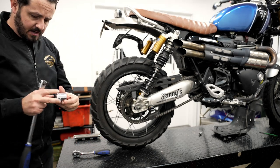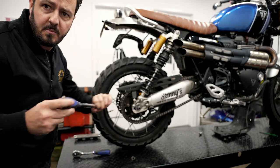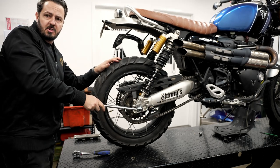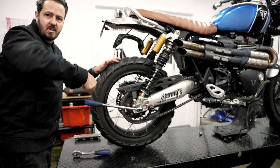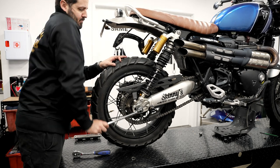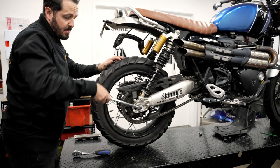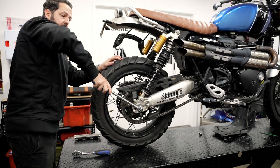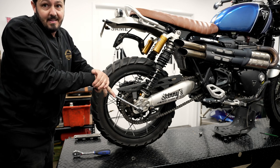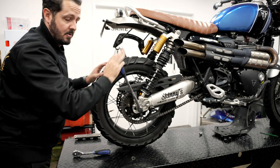The tools you're going to need are a 27mm socket and a pretty big breaker bar so you can get enough leverage. You want to come at it from this side and push downwards so you can use the weight of your body to get more purchase and more power to turn it, because this nut is under quite a bit of torque — you want it tight, otherwise your wheel might fall off. And that would be a bad day.